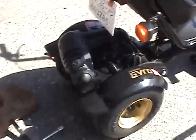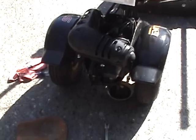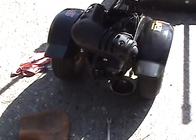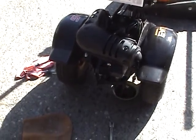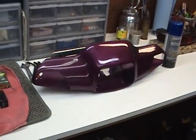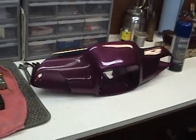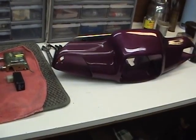Then I'm going to put in a new 10W-40 oil. So I think that's all it takes. It's 10W-40. Of course, a lot of people screwed up that way. And down in here, these are the two adjustments I have to make. The top one is for the slide height. The bottom one is the idle jet. And these are the ones I'm having problems with.